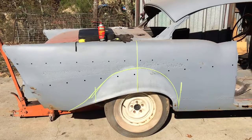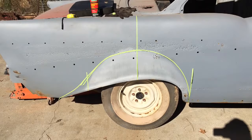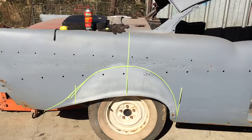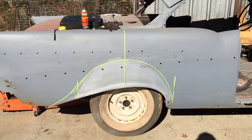So I had a pair of 11-inch magnesium wheels, 11 inches wide, two and three quarter backspace with a 33-inch tire on them. I'm not going to run a tire that tall, probably more like a 31 and a half inch is what I'm looking at with those magnesium wheels. So we kind of mocked this up the other day — I know it's not completely straight, but I'm just kind of getting an idea, looking at some cars, probably cutting it about halfway up the trim for the Bel Air.